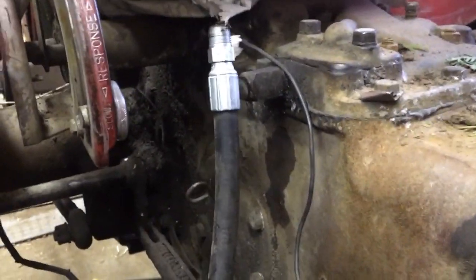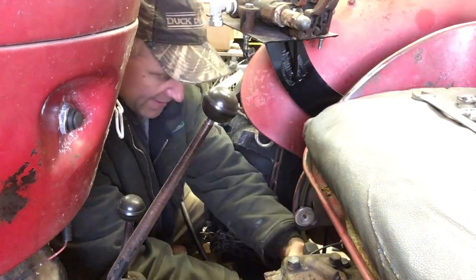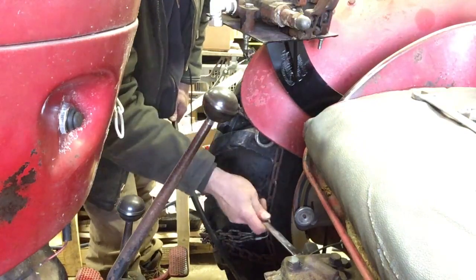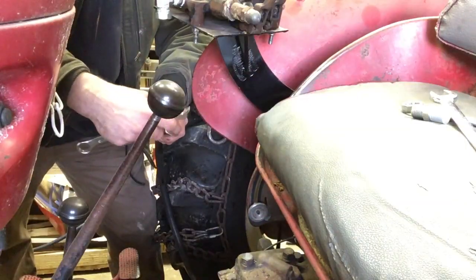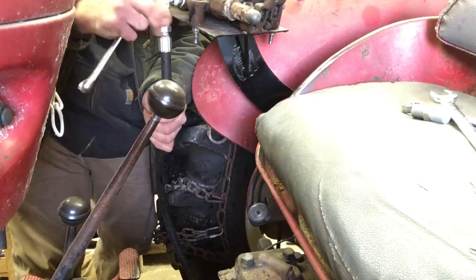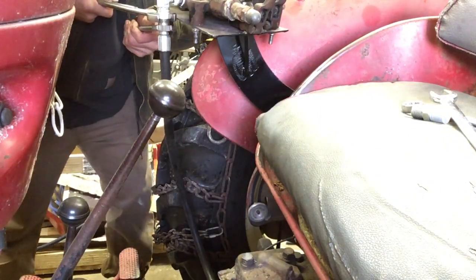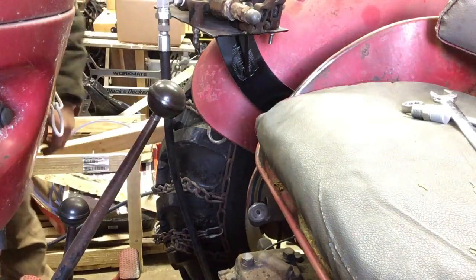Now we need to hook in my feed line up to the valve. You don't want dirt through your valve and all kinds of stuff, so you've got to make sure it stays clean - blow your lines. With these fittings there's a taper in here and a taper in the elbow; you don't have to put Teflon on them because the taper is what actually seals them. My inlet is tight and installed. I'm going to have to put loom on that so it doesn't end up wearing close to the tire.